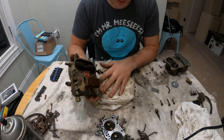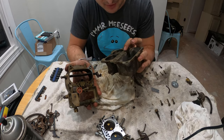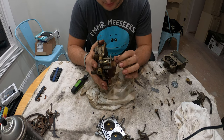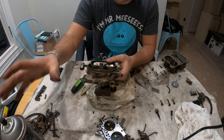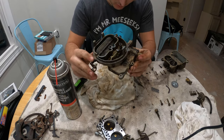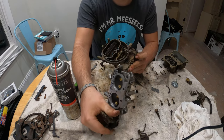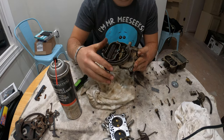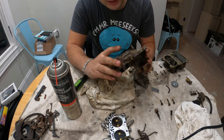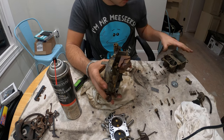So this is pretty much it — you've got your three main parts of your carb: your lower carb, your middle carb, your bowls, and then a bunch of jets, lines, and holes. You've also got your floats and these needle tips right here. This being my first time, I kind of just found every crevice and every hole and sprayed brake cleaner into it. This is actually the only thing I submerged inside that gunk cleaner — you can see how it's really clean compared to the rest. Inside these jets I'm looking at the carb rebuild kit and there are little O-rings between everything, so I was afraid if I fully submerged one of these things it would eat away the gasket.